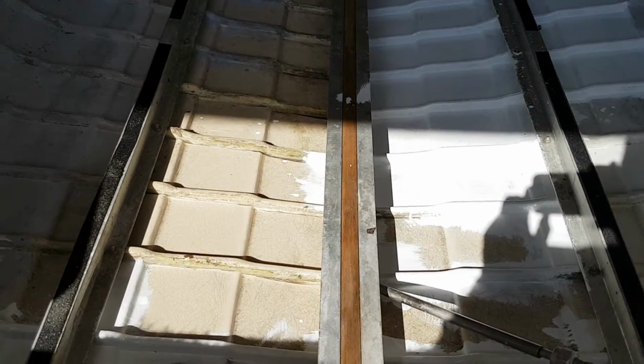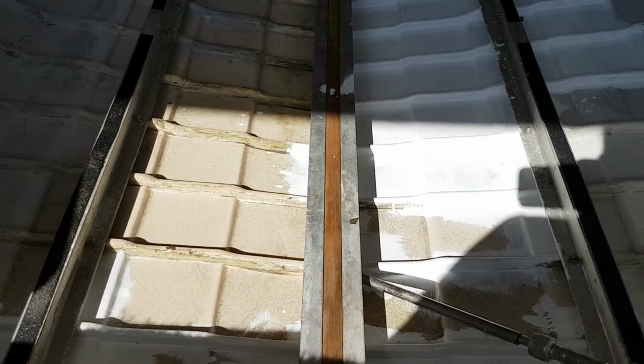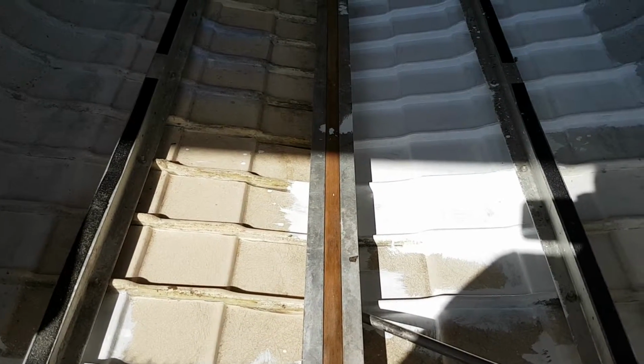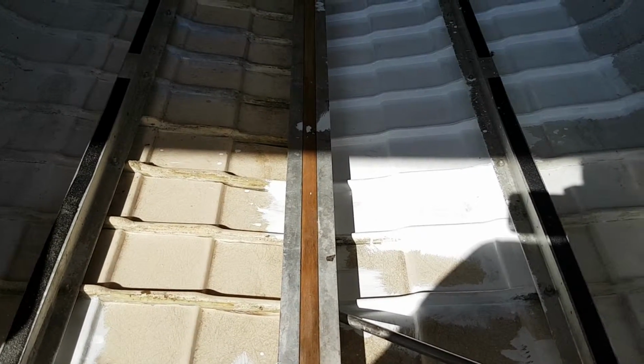So the bilge down here was starting to show a lot of age. There was even some fibers coming up through the first layer of fiberglass here. That's a warning sign for anybody. It was only happening in a couple of spots. I threw some resin over top of it just to reinforce it and let that dry. And then I'm starting to throw this paint over it.